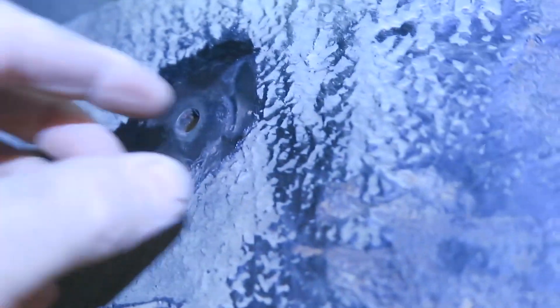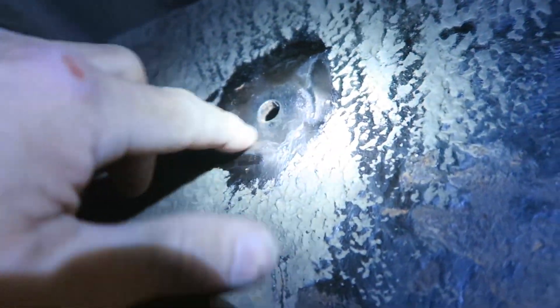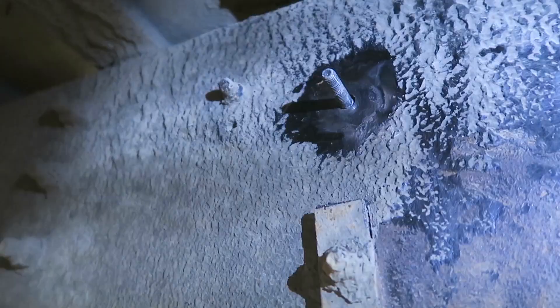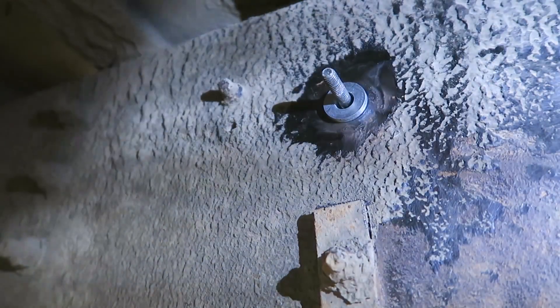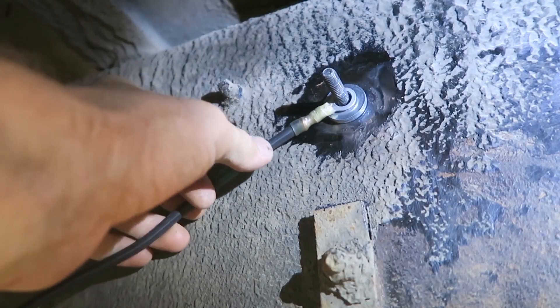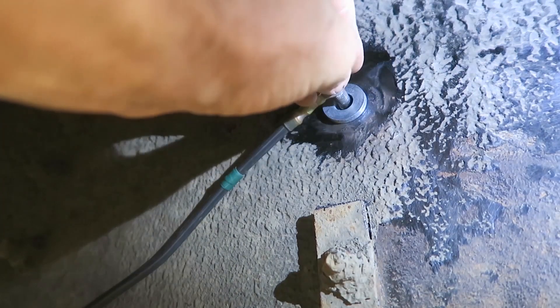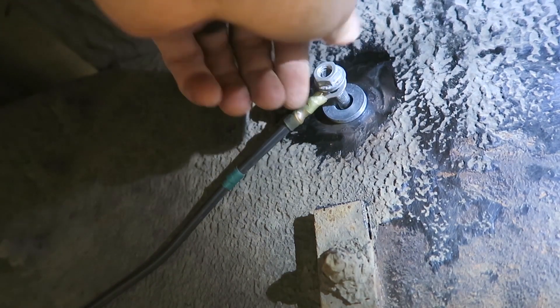There's a hole right here and I have a bolt that fits that. I've ground that down. Even though it's a bit discolored and brown, it is pure metal — I can feel it and I can see this shiny metallic surface. I'm taking one of the old bus screws, putting it through here, and then I've got two washers that I'm putting over it. Those will contact the metal. I've got my ground wire going on top of that and then a lock nut and a metal nut to go on top of all of it.